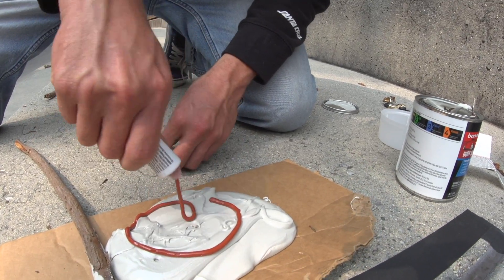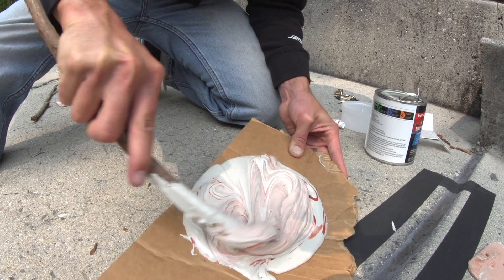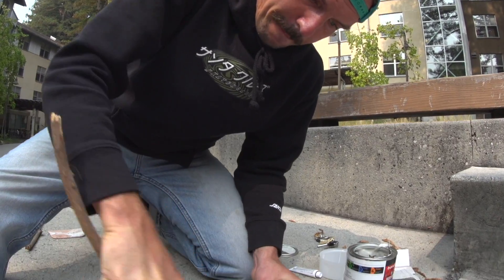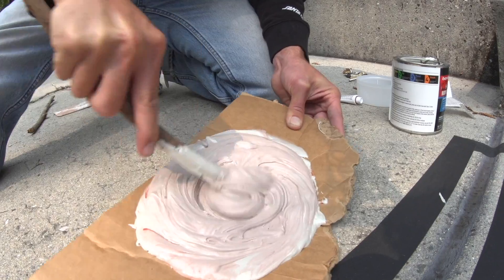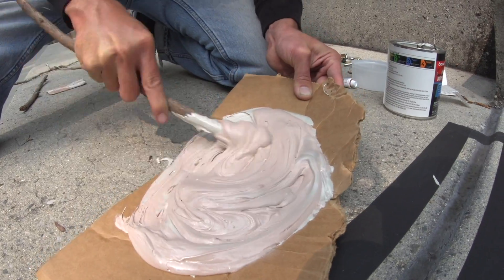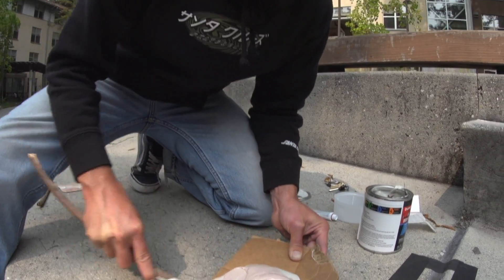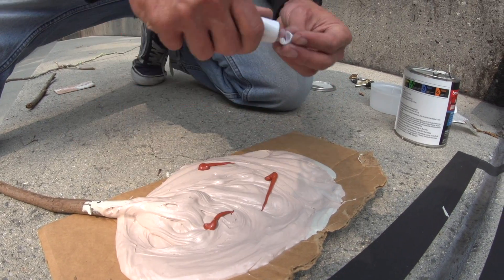Bondo's out, putting the hardener. A lot of people overdo it — I go with a little bit of hardener. I normally go with about a one-sixth of the total amount of bondo. A lot of people put in the hardener really quick and then end up not even getting it off the tab before it's too hard. Get that thing mixed in there — do a nice salmon color. I do just a little bit more, just for good measure, and then it's gonna be good to go.